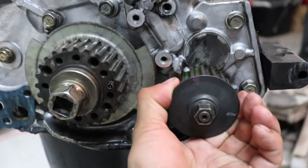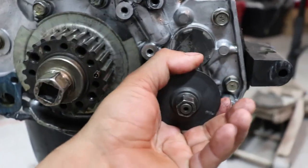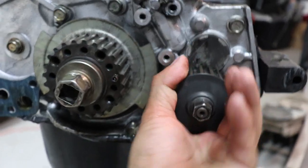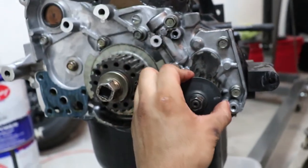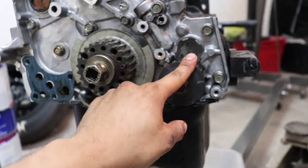So this is the oil pump here. You can kind of see that this pulley — the oil pump drive sprocket — it doesn't even move. I have to really turn it extremely hard, so I'm thinking something got messed up with the gears inside. But we did order a new oil pump.